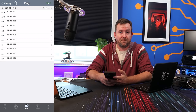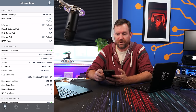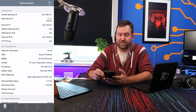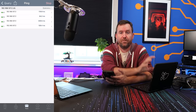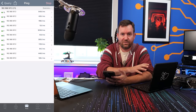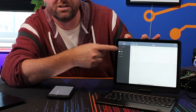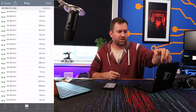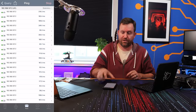Now let's connect to the main secure network. I have an IP address of 192.168.42.12. Running the same ping test to 192.168.107.2 — now I'm receiving ping replies from the tablet in the IoT network. We've proven the guest network cannot see into the IoT network, but the secure network can see into it. However, if I run pings in the other direction from the tablet to my phone, that also works — so we still need to block IoT from reaching the secure network.